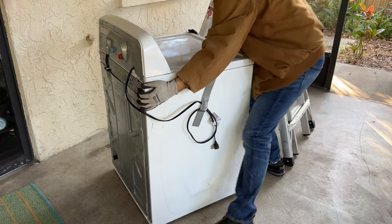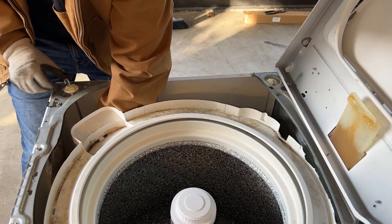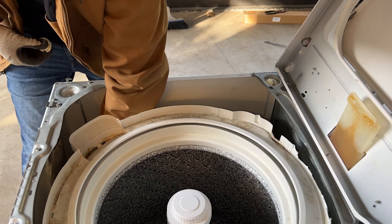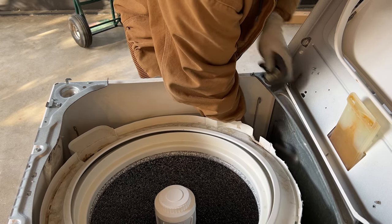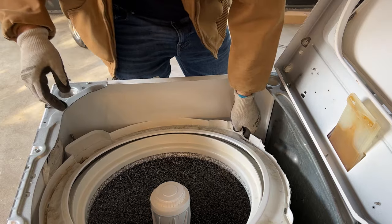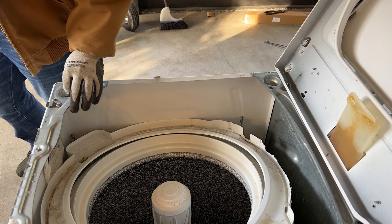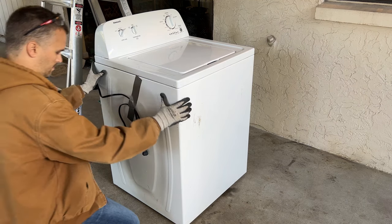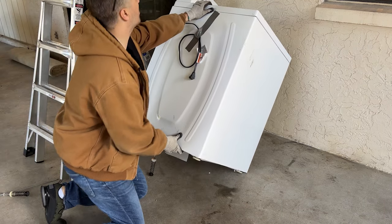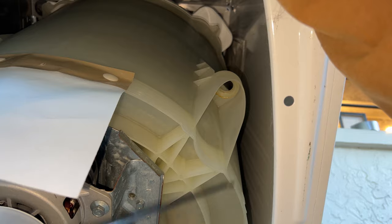Now that the rods on this side were done I put the top back down and rotated the washer around so I could start on the other side. I opened up the top of the washer and leaned it up against my ladder. This side is the exact same process as the first — I lifted up on each of the rods, slid them down through the plastics, and let them fall inside of the washer. I removed the old plastic cups from both of the mounts and installed the new ones. Then I lowered the top back down, leaned the machine up against the house, and got at the bottom again — this time both of the rods just fell out on their own. I went ahead and took both out, tossed them aside, and installed both of the new rods.